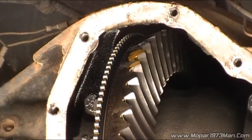You can see the ring. And just left of the ring, there's a kind of gear tooth sitting there. That's the exciter wheel for the speedometer sensor on top of the pumpkin. It's used for the ABS control as well as the speedometer itself inside the cab.